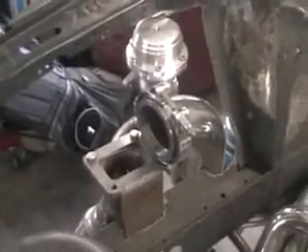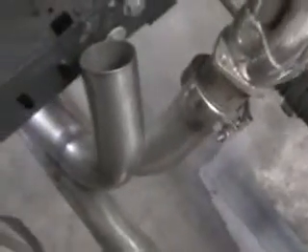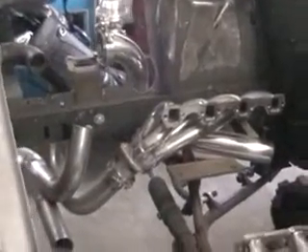You've got a turbo on each side, very symmetrical. This side I've already kind of did some sheet metal and kind of frenched in the wastegate and what not — got to do the same thing over here and I'll walk you through that as we do it. So you've got the turbo here facing forward, the exhaust goes out the back, it's going to turn down and go right under the K-member. Off the headers it just goes down, wraps around, goes under the frame rail, comes back up the other side — same thing on both sides. Once the engine and turbos are in here, everything's pretty hidden, not a lot of tubing. That's kind of what I like — I like the simple look.